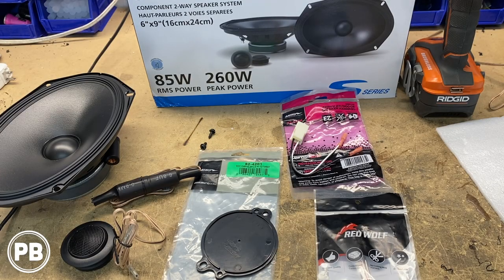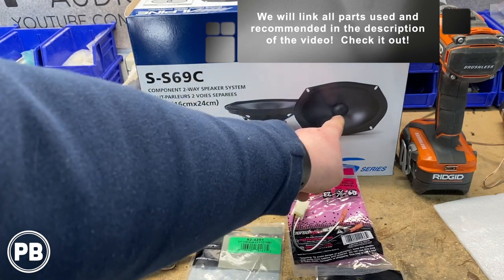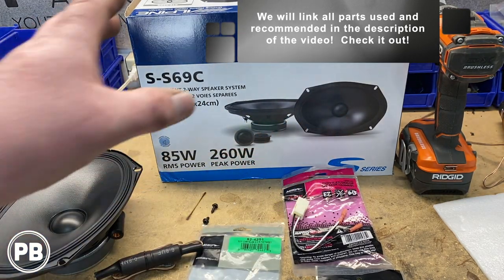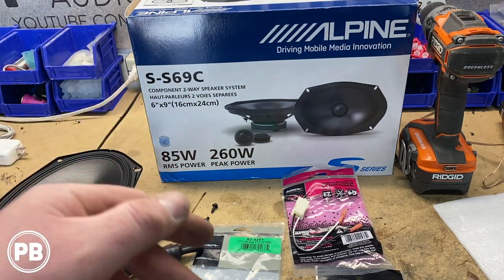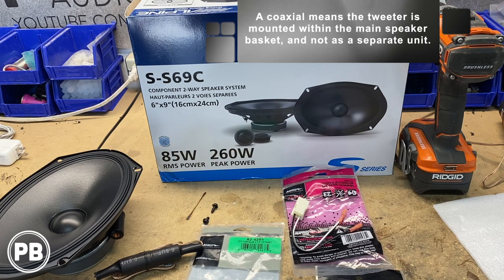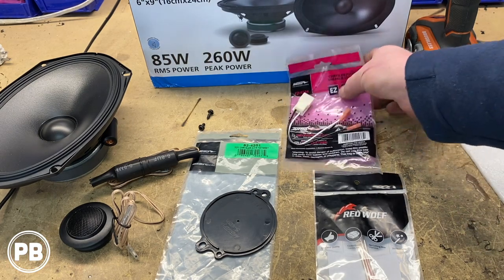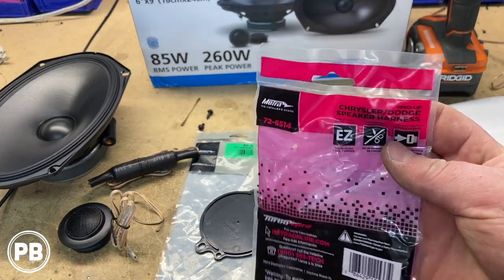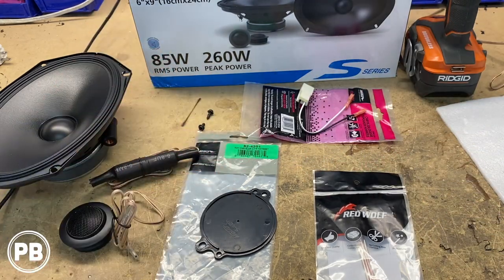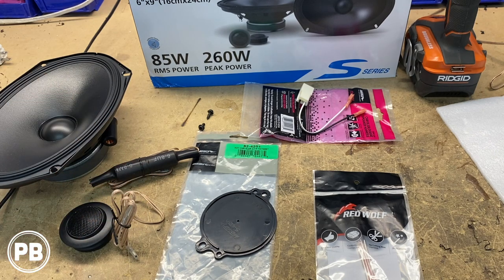So we're here at the bench. The component set we're going with is this Alpine 6x9 inch component set. The tweeter is a separate tweeter with its own passive crossover — a great setup in our vehicle considering we have the tweeter in the dash and not in the door, so we wanted those separate with their own crossover. You can get a coaxial set and we'll link that in the description. But since we have a space for tweeters, why not? To accommodate these speakers in the factory location, we'll need a couple of harness brackets and adapters. The door speaker bracket adapter is the Metra 72-6514 — it comes in a pair. We don't need a bracket adapter if we're installing a 6x9, though the speaker did come with a small spacer that we'll probably install. If you're doing a 6.5 in the front door, you'll just need a 6x9 to 6.5 inch adapter, and we can link that in the description as well.